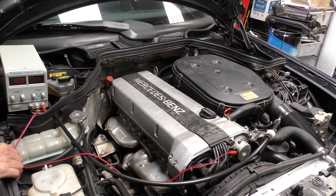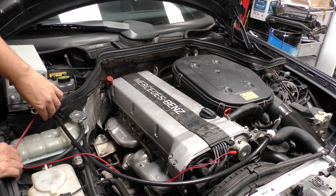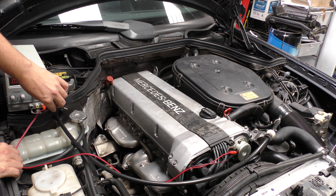Now when the magnet is energized, on this catalyst version car, the RPMs do basically hunt and the engine almost stalls when it's first connected. There's also quite a pungent smell from the exhaust while it's doing this as well. Non-catalyst cars may behave differently — they may just rock around in their engine mounts and probably not try to compensate.